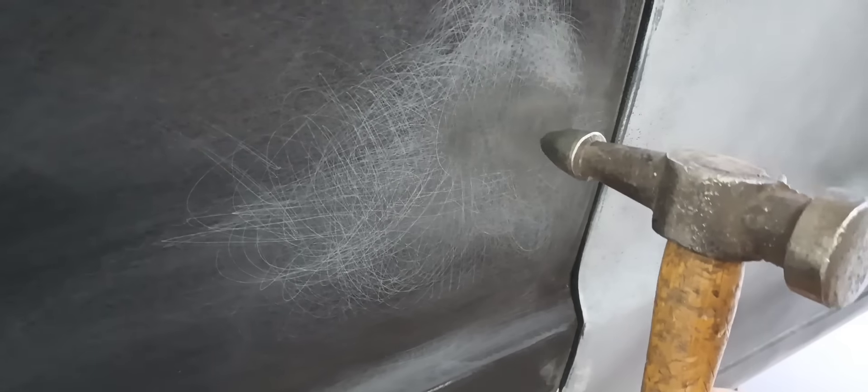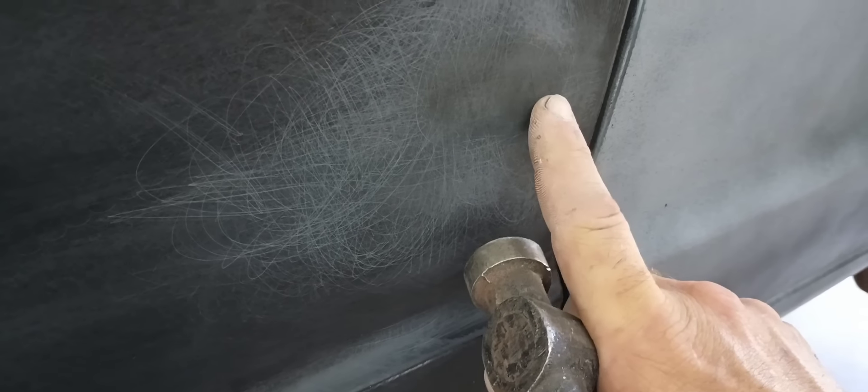What you see me working on there was that dent from the inside. What I done - I took a pointed body hammer and started in kind of a circular motion and worked in towards the center. As you can see, I hit it with a block here and we just have a very very small low spot right there right now, so just take a nice little skim coat there and we should be good. Some of these smaller sunk-in little dents will just get filled mostly because they're super shallow, so a skim coat of filler will take care of those pretty easily and stay under that mythical eighth-inch-thick mark. I think at this point I'm ready to skim my door, so let's get to it.